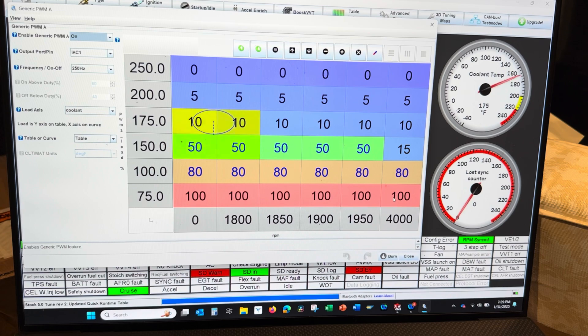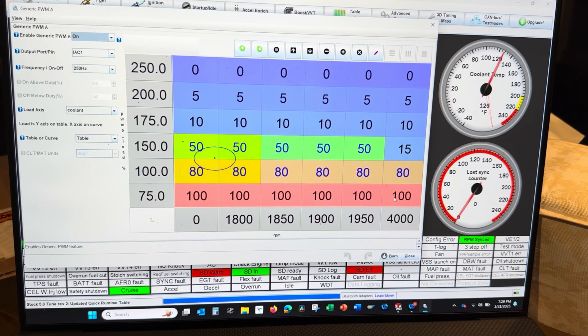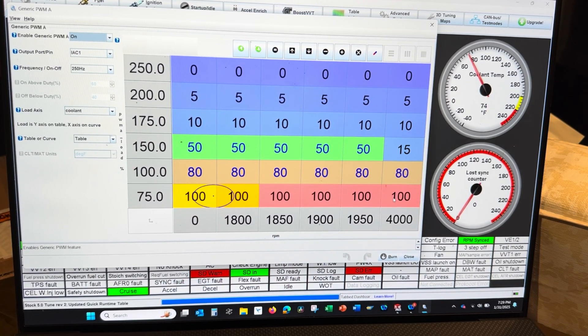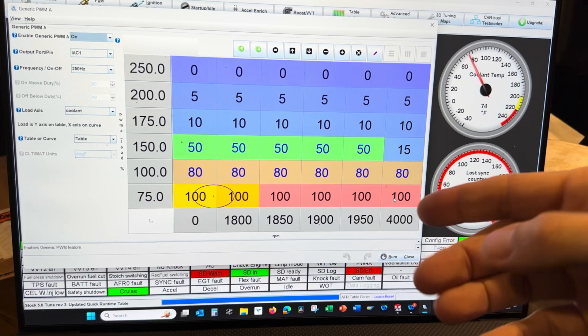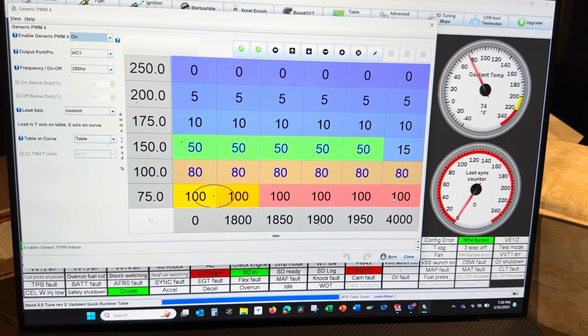You can hear the fans start to increase as PWM decreases. Dropping back to around 100 degrees C, you can see the temperature falling, and then dropping it down shuts the fan off completely. One thing to keep in mind when programming fan speed is that many fans aren't happy operating at low speeds. Use a duty cycle that puts the fan at least 50-75% of its maximum speed to ensure long fan life. The way I'd set this up is: 100% duty cycle up to about 180°F, then 50-40% duty cycle, ramping down to 0% — which is full speed — at around 210-220°F.